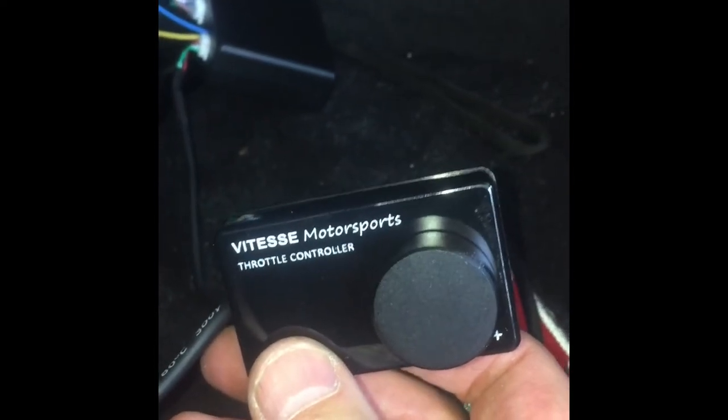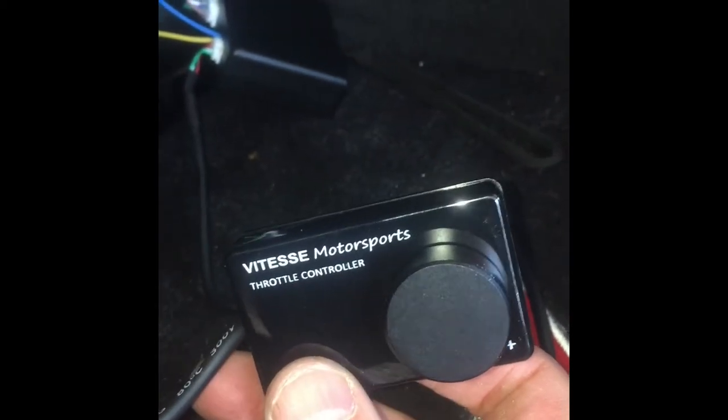That's it — the rest is just hanging loose for now, but we can calibrate it and get it working. I'm going to use some double-sided tape and stick the module up under the dash somewhere to keep the wires out of the way. I might put the controller unit in the ashtray or near the console. I'll calibrate it first, then worry about final mounting. Also, when pulling down the panel, remove the light — there's a little black clip that slides out, then pry out the two tabs on both sides and the light drops out.